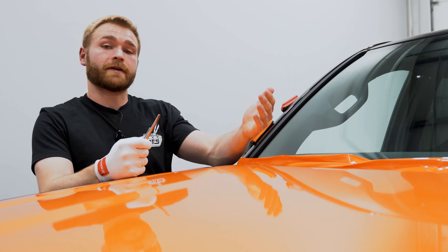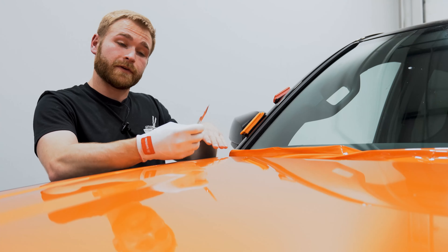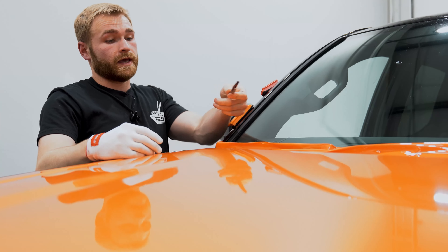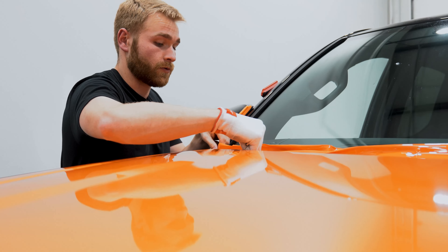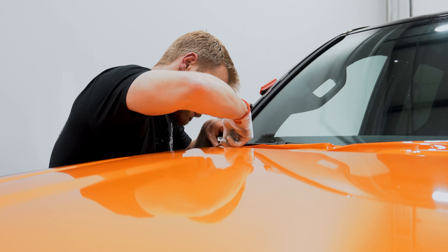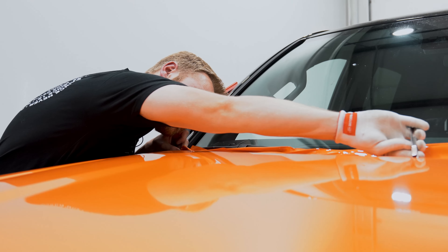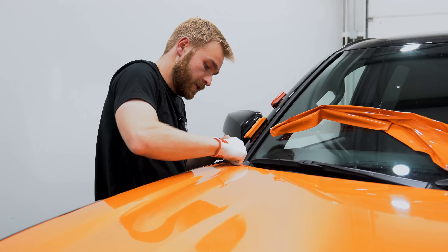If you're right-handed, the driver's side of the vehicle is going to be a little easier. For the passenger side, you can take your blade and start on this side and cut that way, which will feel more natural. Some people go underneath the hood, some people use their left hand — it's really preference. Today I'm going to start at my corner and go that way because that's going to be the most comfortable for most people to demonstrate. Again, go back and make sure you push that edge all the way down.